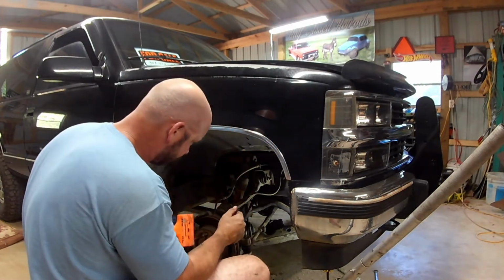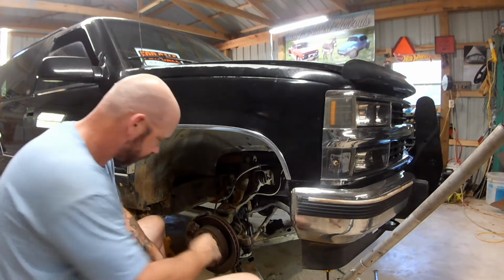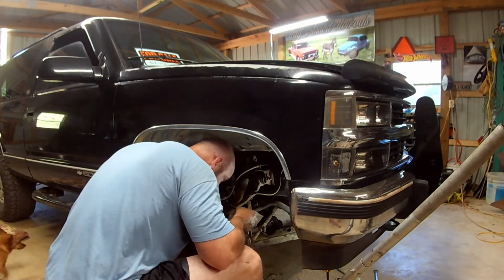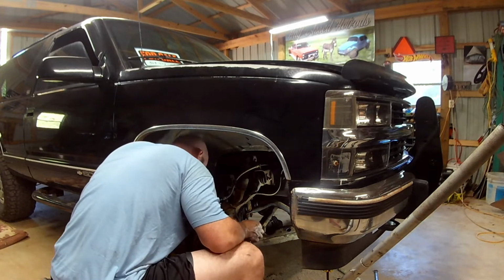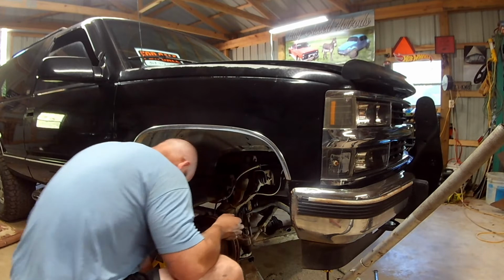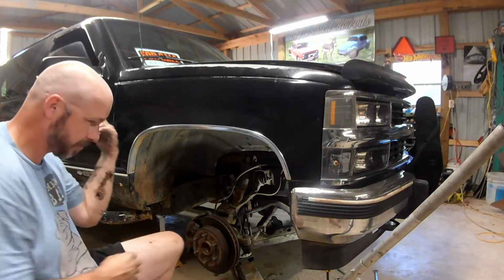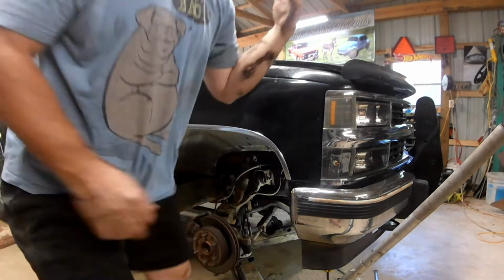And all I'm doing is bringing my pry bar back to me, not really moving that bolt. Well, I guess we'll try removing the shock bolt. See, that should flex enough. Assuming that that's not rusted beyond all possible usefulness. There's some more grease.